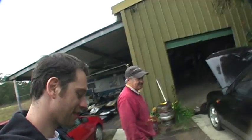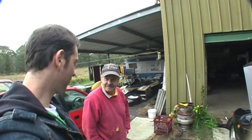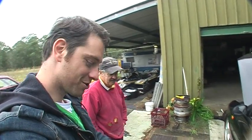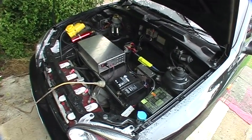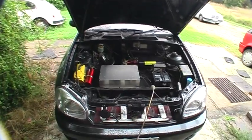The first thing I bought for my electric car at a garage sale were a couple of 50-cent computer fans to vent my battery box. Which I now won't need — well, you don't need them with the lithiums, that's right. I'm using batteries that don't vent hydrogen. Something handy to have around — we used those same things in the battery chargers we made.